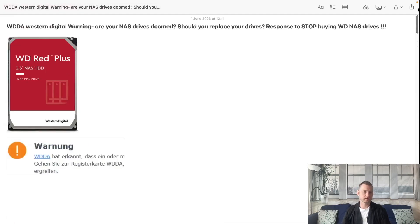I hope this video was calming you down, because I saw so many people stressed and worried about their data and their drives. Just to reassure - this is just a warning. I hope Synology learns a lesson and updates DSM. They should stop pushing their own drives agenda, because based on this, people might consider buying Synology drives because there's less hassle with them. But remember that internal checks like WD's internal checklists or Seagate's health management software on the drive are very crucial. Synology drives do not offer this, but other brands do - so do not ignore this.